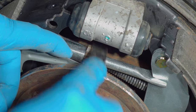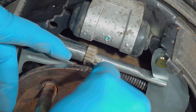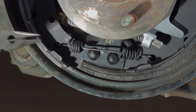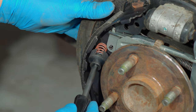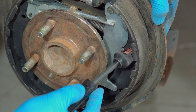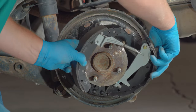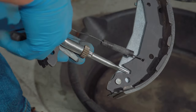In a lot of vehicles, the brake springs and shoes are reversed on the opposite side. It's also a good idea to purchase the parts you need and match them up to the parts on the vehicle before disassembly. Turn the brake adjuster with a screwdriver or brake spoon to relieve the tension on the lower springs holding the shoes tight. Use pliers to remove the springs. Remove the brake shoe retaining pins. Start removing the old shoes by pulling them away from the backing plate, allowing access to the spring holding the shoes together behind the star adjuster. Loosen the star adjuster and remove the spring, which will allow the left shoe to be released from the other shoe.